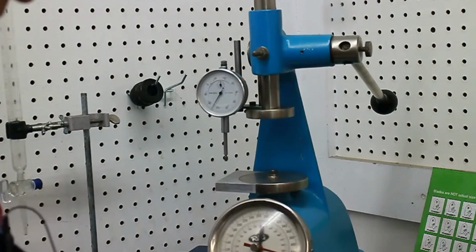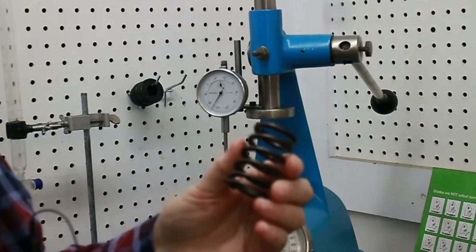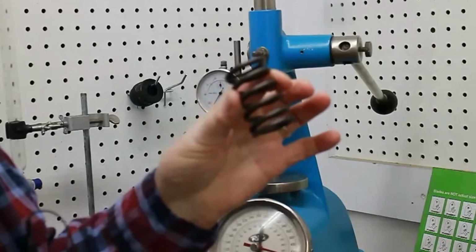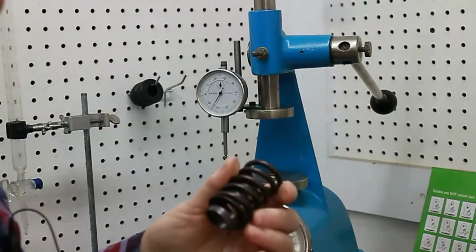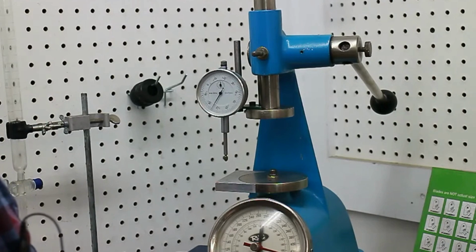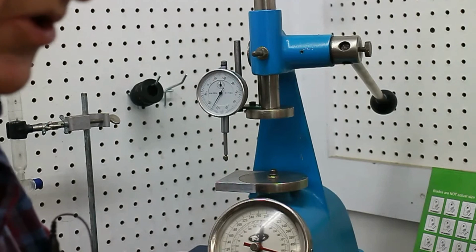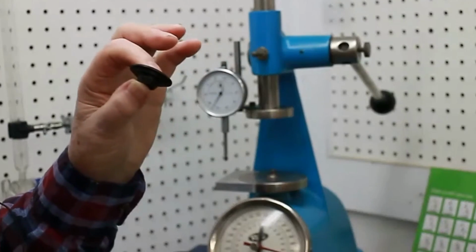Now a little bit about the spring in general here. First off, what makes this spring a fairly good piece is that the mass of the spring itself, for the poundage it delivers, is low. This is an 88 gram spring, and with the damper, which is a nice fit in there, so that's a quality damper, it's 104. This gives us a resonant frequency of about 31,000 cycles a minute. That is good. That comes up in the higher level of spring technology for what we're applying it to here. So, good hardware. Also, last point, the retainer itself for a steel retainer is light.